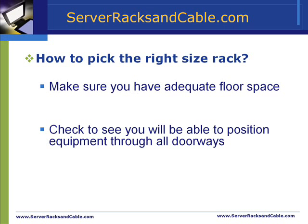Additionally, make sure to always use appropriate rack loading methods, including placing the heavier pieces of equipment at the bottom of the rack to prevent it from becoming unstable and too top heavy. Make sure to decide what you want to put in the front and back of the rack based on when and how often you will need to access or remove equipment. Have additional persons assist in loading equipment that is too heavy or above your head.